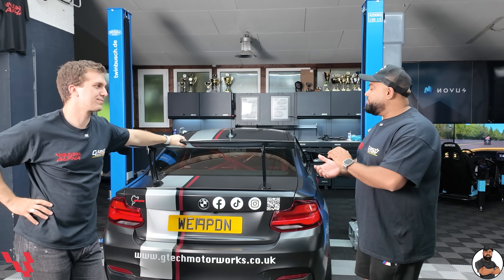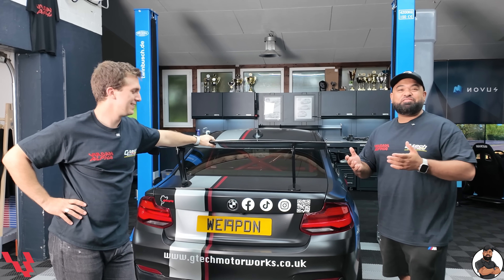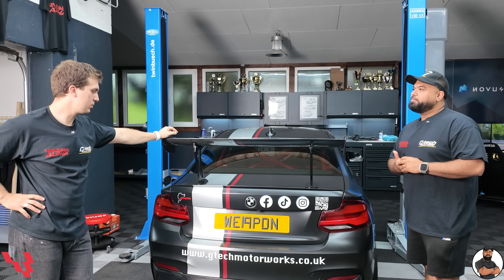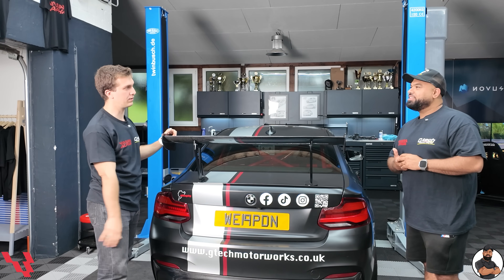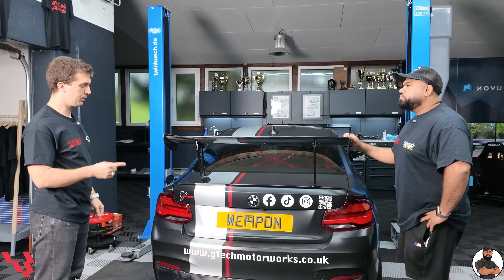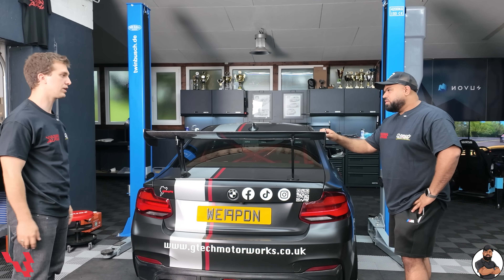So Lapo, let's get straight to it. I'm on a short visit — I'm literally here for like 72 hours. I've come for the big wang. So first thing is to open up the boot, take off the wing, take off the interior panel. Then we're gonna have to take off the boot, put it on the bench, mock up the brace. The brace is gonna allow us to center the mounting holes, so we're gonna drill it and then put everything together.